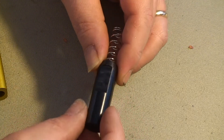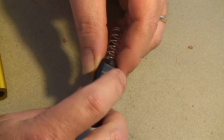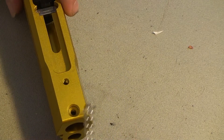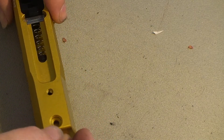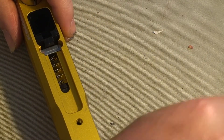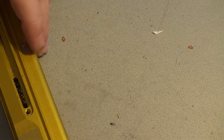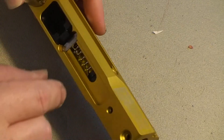Put the spring back in. You'll notice there's a flat on this pressure pin — when you put it back in, the flat should line up with this channel right here. Slide that back in, and you can see the flat is lined up with that channel. What that'll do is when we're ready to put the connecting rod back on, it'll allow the hole to line up.